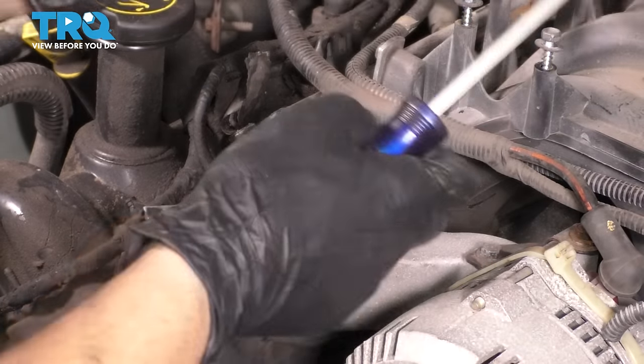So now, don't let go of it, because it's going to skip. And because this side is the tensioner side, it's gonna have to have slack on it, and on the bottom, we'll have to put tension on it. And at the top here, like I said, make sure you line up the sprocket with the proper links, just like this. And let's see, we're probably gonna be a couple teeth off. Yep, that's fine. We're actually not too far off. I'm gonna stick my 3/8 drive extension in there so I can turn the cam. Oh, one more tooth. Okay, right there, put the chain on.